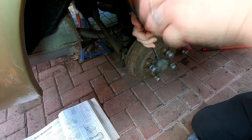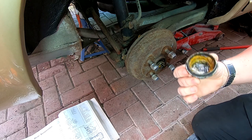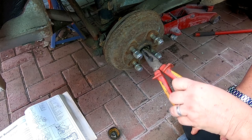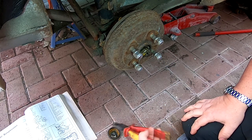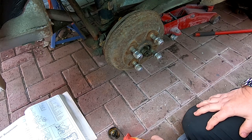So this is all new. It has been packed with grease, but as you can see, it's very old grease. We have got a split pin in there, which has obviously been out before because it's broken on one side. So let's just withdraw that. I should have my gloves on — I've got a pair of gloves over there, but you know me. The little cap comes off, and there's our bearing nut.